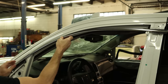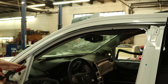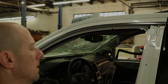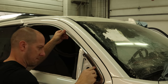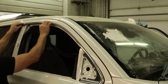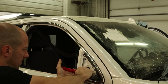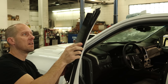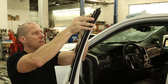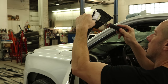And onto the doors. Put the upper molding on and put our rivets in — still don't feel like listening to the compressor; instead, we'll listen to the heaters. So we'll snap the molding in, clip it on the seam all the way around, and then put our rivets in. I'll put the rear trim panel on — it slides in at the back. There's a little piece of two-sided tape we'll pull off at the top. Now we'll slide it in and snap it into its clips. I only get one shot at these — these clips don't survive.